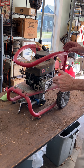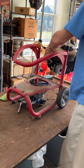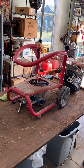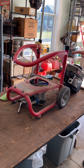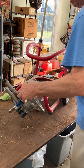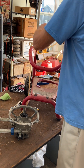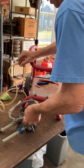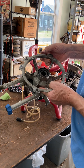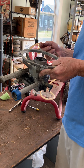Let me put my camera over here so you can see what's going on — this is how you turn a pressure washer into a lawnmower. I've got everything loose here; I'm going to lift the engine up and get it off. You always want to tilt the engine back to keep the oil in. I've removed the fuel tank so I don't have fuel leaking everywhere, and I want the oil to go to the back. So there's the pump that was on this washer — that's the detergent hose. It looks pretty crudded up in there, so I'm not surprised it didn't work; I couldn't get any pressure — it just sort of dribbled out.